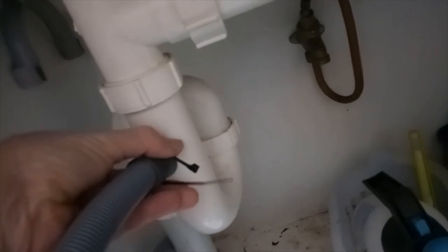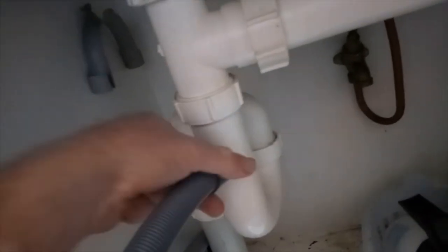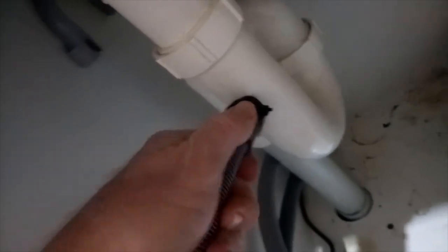The first one I'm going to put on is the drain hose. Now, I have noticed that there's no clamp for the drain hose. It does fit on there pretty securely onto the drain port, but just to be on the safe side, since there was no clamp, I've got myself a couple of cable ties. Two small cable ties, just because it's probably not likely to happen because it's all low pressure, but if that hose comes off and runs, it'll pump all the sludge water into the cabinets, which is not nice. So I don't expect that to happen, but just to make sure it doesn't, I'm going to put a couple of cable ties around there. I've got a couple of cable ties there now, and that doesn't come off, so that's good.